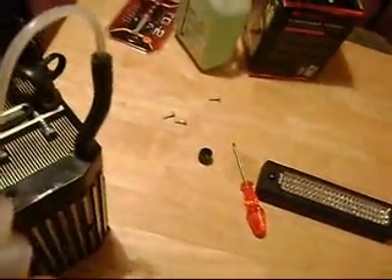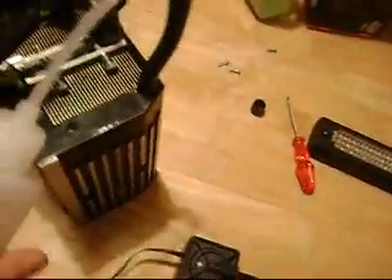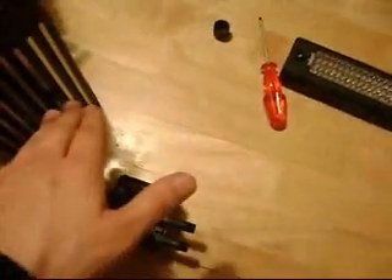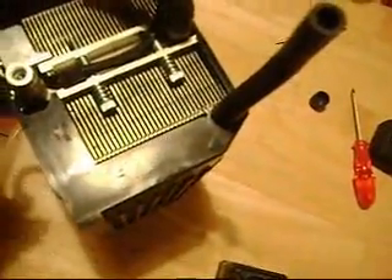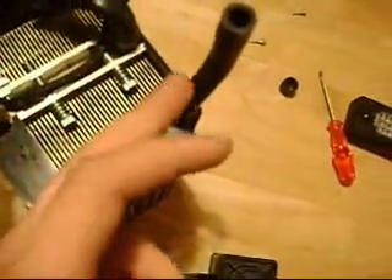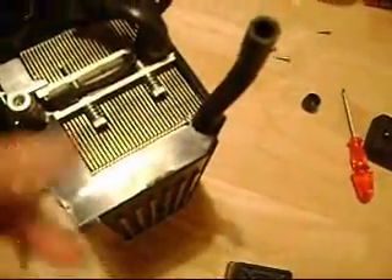Put this thing in as far as you can, and when you fill it up the liquid goes down. Eventually it clogs against the condenser, so you carefully take it out and refill from inside to get the liquid all the way down. A good idea is to use a screwdriver to press the black button to open it so air can escape — when the liquid goes down it comes out here, which helps flow a lot and shortens the time.